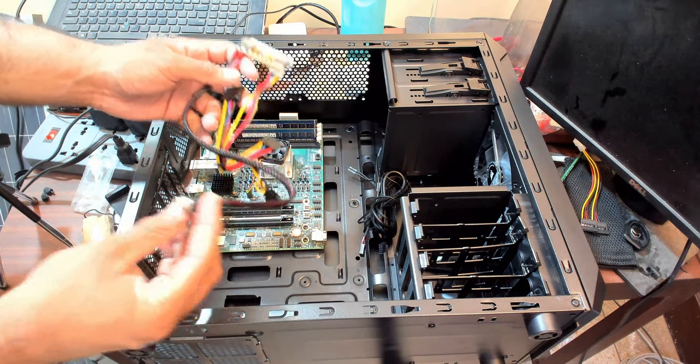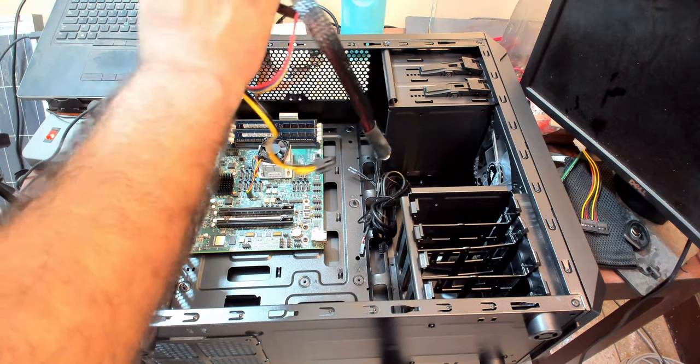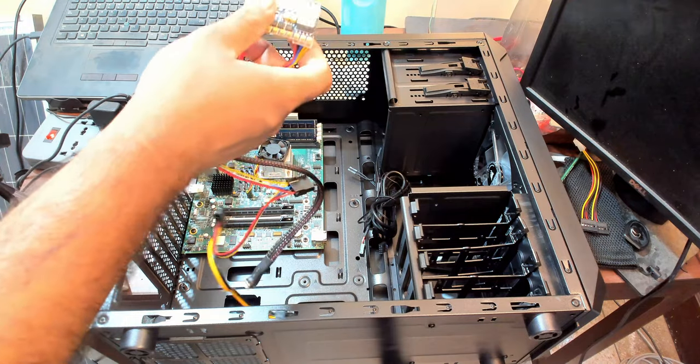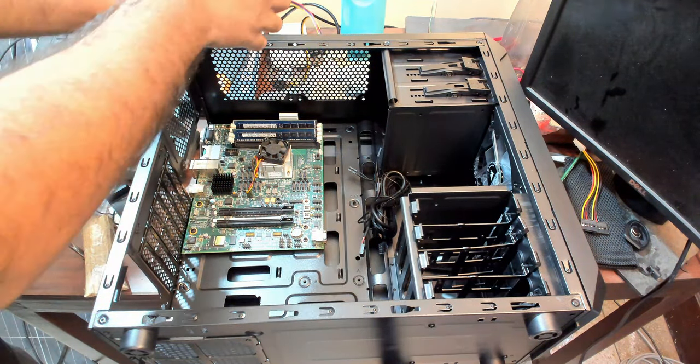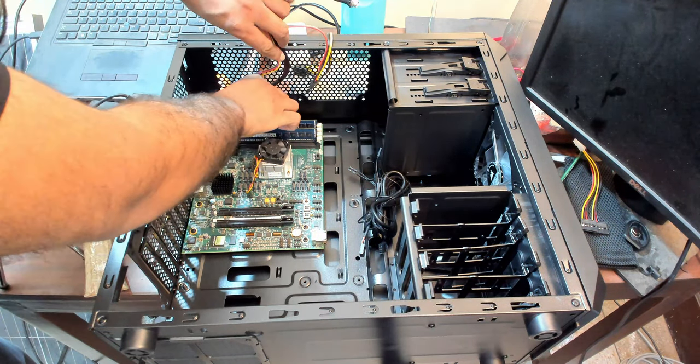So you get this barrel jack connector and you just use that to power everything else up and do that externally. So all the DC conversion is external. All the power supply is doing is smoothing the 12 volt and then providing the 5 volt lines, and it goes in simply over the 24 pin connector.